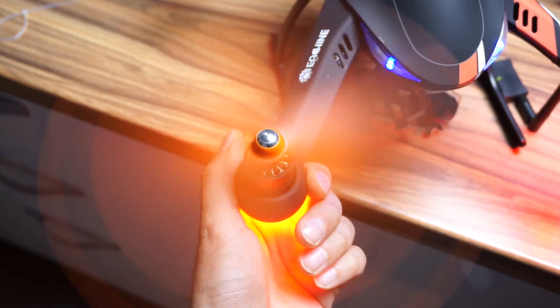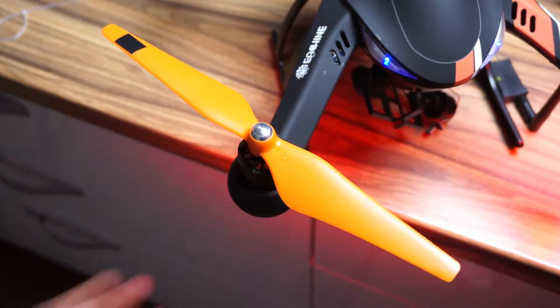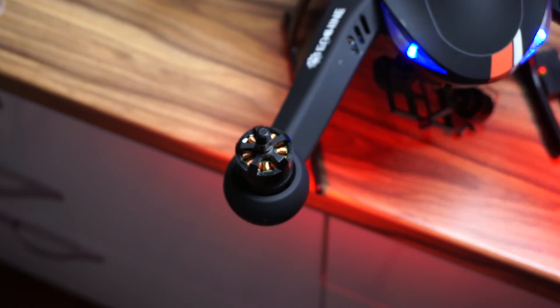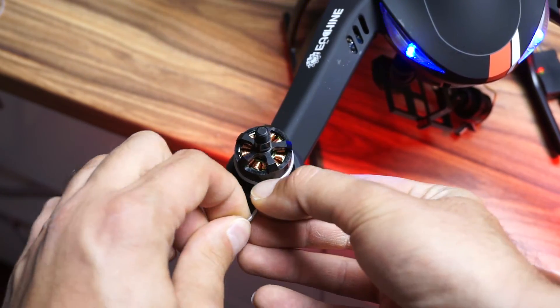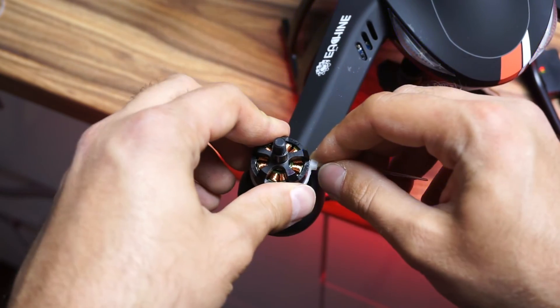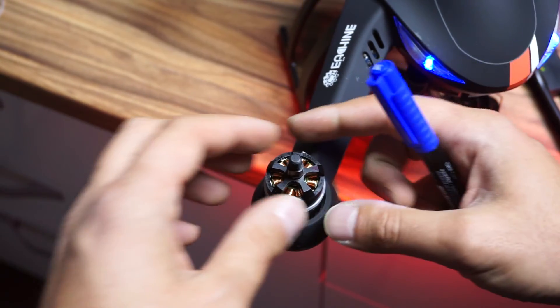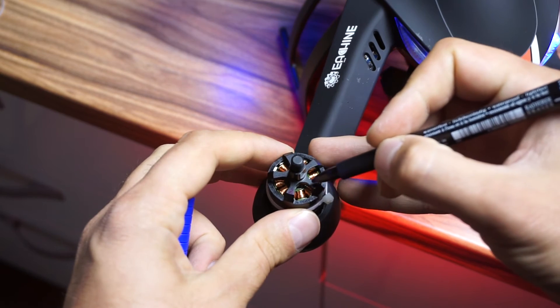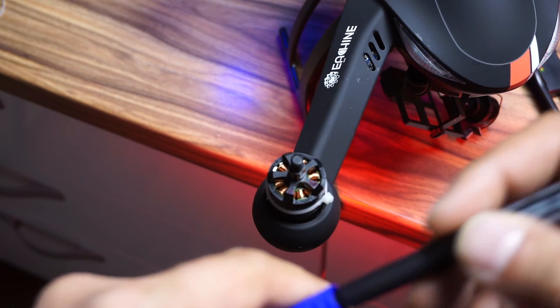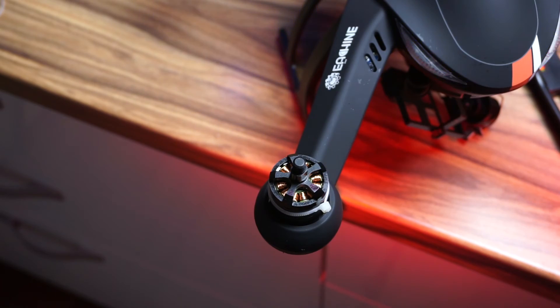Please try not to cut yourself on the propeller. I've been doing this for a while and I'm used to it and I haven't cut myself yet. Once you determine that the motor and prop need balancing, you take a zip tie and tie it around the motor bell just like that. Once tightened properly, cut off the excess, then just pick one of the ribs on the bell on the top and align the bulk part of the zip tie with that one.